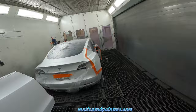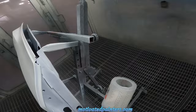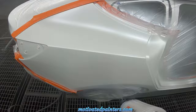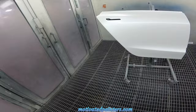I'm going to put another coat on and then we can move on to clear. I'm going to keep it at 27 psi and put an even coat. Make sure I put some on the inside, because on the inside they don't really have those curls, so this one coat will be fine. I'm not going to put a control coat on this — it doesn't need it. Okay, I'm going to make some clear — I'm going to use EC530 for this.